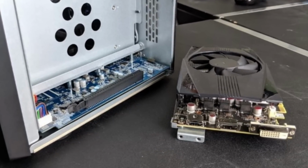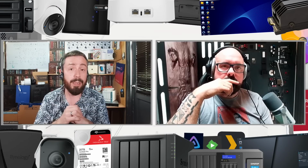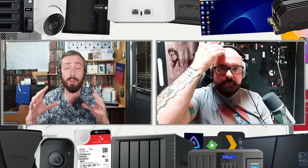You have absolutely hit the nail on the head once again, because the graphics card support does vary from card to card as well. So overall, even in the NASs that have actually integrated graphics cards over the years, such as the Synology DVA appliance that's got a graphics card inside, it can only be used for surveillance. It doesn't even utilize the HDMI out for a local input. Ultimately, I could try to put up something of a vague fight to say, yes, there is customization in NAS, and there is customization with the utilization of containers, but the true scalability is still built within quite a rigid infrastructure.